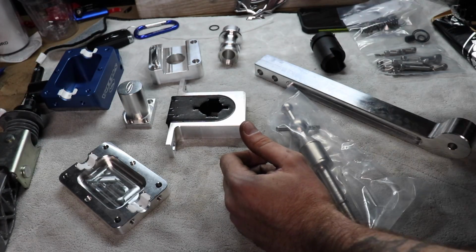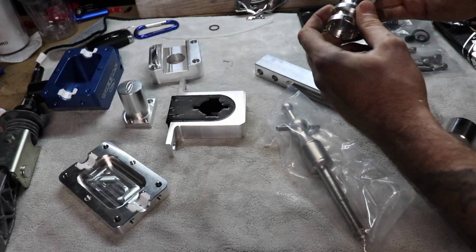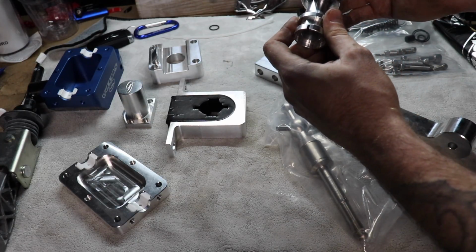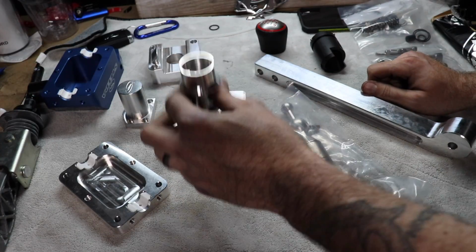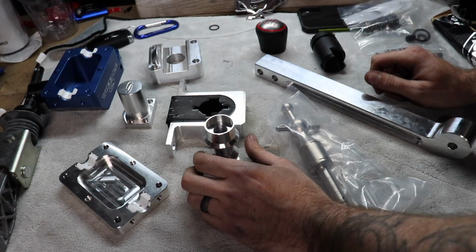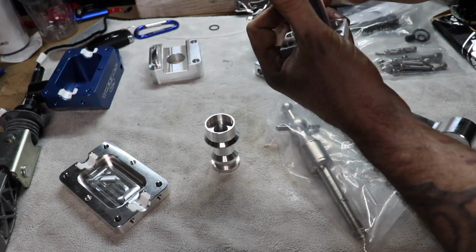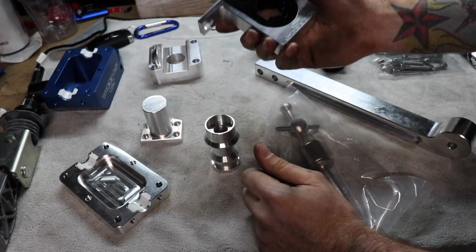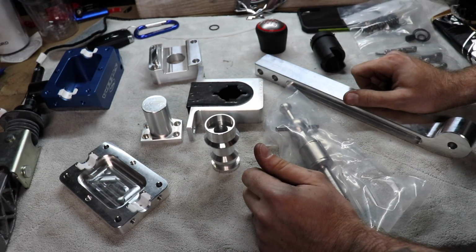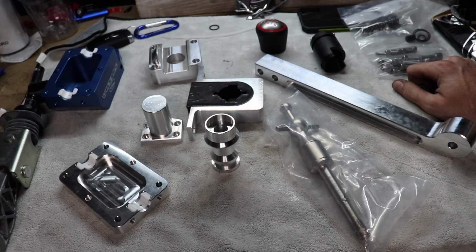And the cool thing is with the GT350 shift knob, you have their version, and it has some play in there. So this won't interfere. It'll make for smooth reverse lockout action, if you will. And then they use their single bracket there, and it's really tough to get that thing in there. This is kind of an oval shape, and when I used it in my 16 before, it works very, very well, and there's very little movement. So what we're going to do now is assemble this bad boy, throw it in the car, and then I'll show you the slop from the install, and then that'll be it.